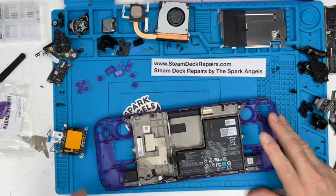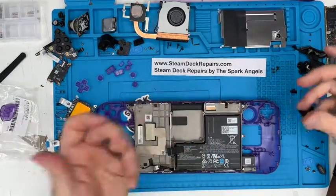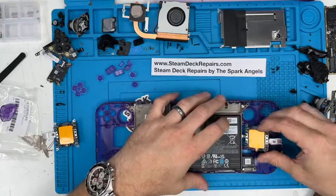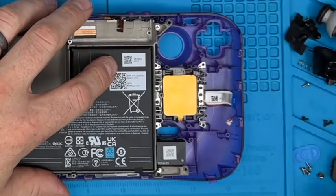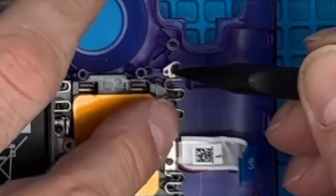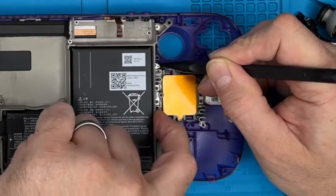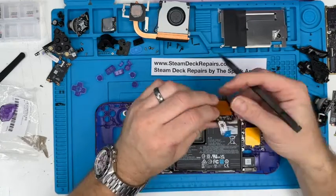Let's start looking at building this up. So as you look at it, left and right is almost opposite. This is left, this is right, because when you spin it over, left and right. And on these, they've got the L and R on there. So we're going to go with the left, sorry, which is our right now. Right. That goes underneath that magnesium lug, and there's little sort of vertical spigots that it lines up on, those little holes there alongside the screw holes that it sits on. Make sure the springs aren't too bent out of shape. Obviously we have to give it a bit of manhandle, so you want to make sure that they're not horrendous. If they are, then just give them a bit of a bend back, I guess, yeah.